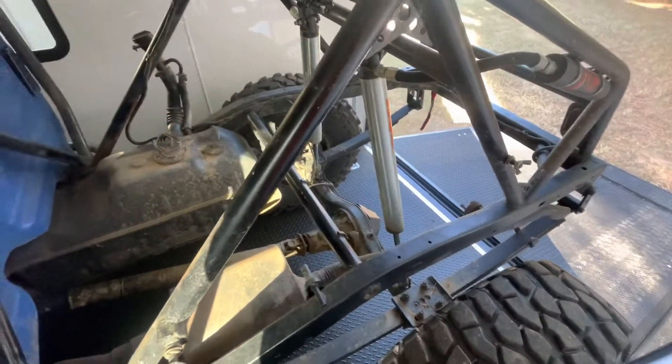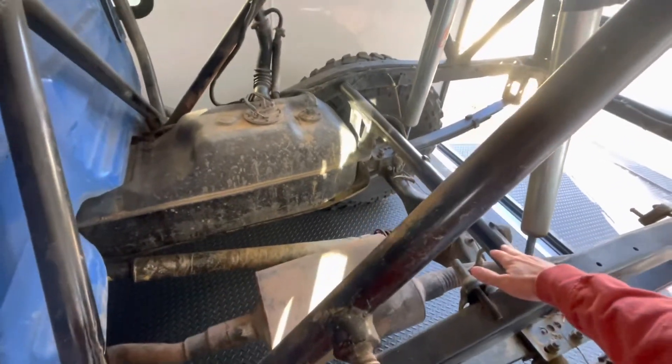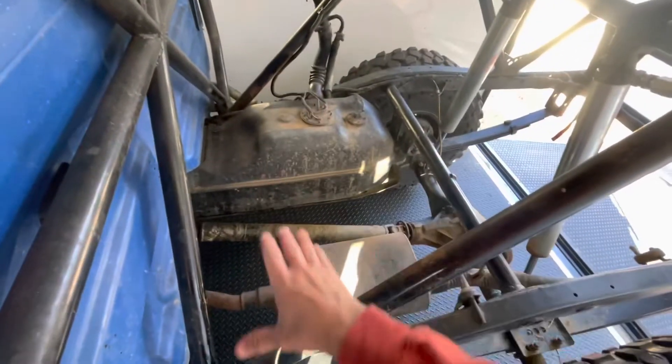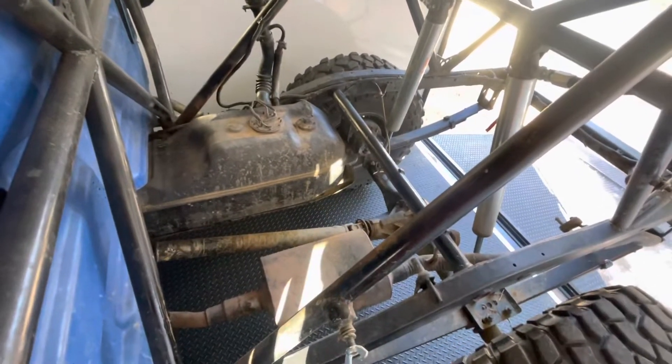I'm here in the trailer. I've got the Toyota, I'm about to unload. I want to show you guys — I cut out the cargo tray. I used to have a cargo tray right here, mounted to the tube, the crossmember that holds the fuel tank. That cargo tray used to cover the fuel tank and the muffler. I would have my cooler and my tools strapped to it. I've cut that out because I'm going to build a crossmember to hold the RCI rock crawler fuel cell that I'm going to install.